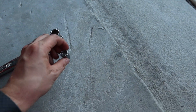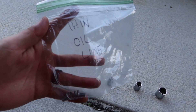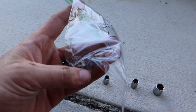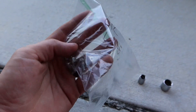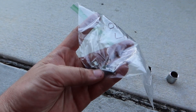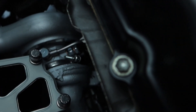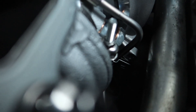Since we're dealing with the thin oil line now, here are the other two little bolts — these are also 10 millimeters. I'm going to go ahead and put them on the line. I'm not going to snug them down or anything, just get them situated in place. One of these little 10 millimeter bolts fits right there into the bracket.